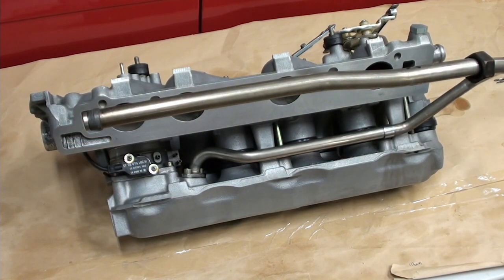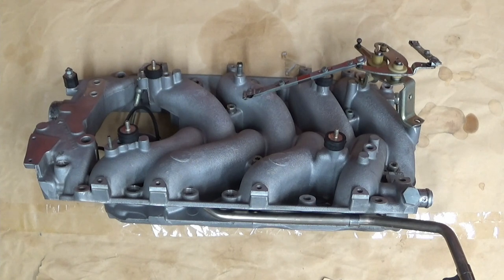So this is where I take the upper and lower and put the two together. I'm not putting the sensors and stuff back on because I don't think you should do that until you actually put the intake manifold back on the vehicle — you noticed in a previous video I had broken that off. Before I reassemble the manifolds, the first thing I do in this video is check the upper intake manifold for warpage.